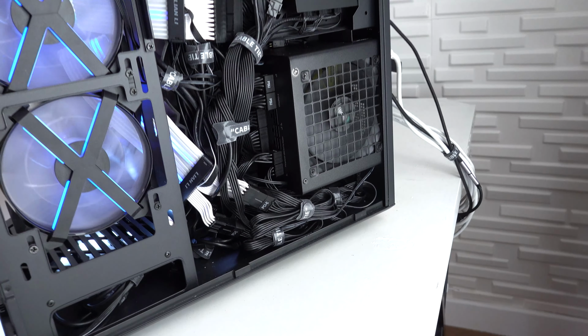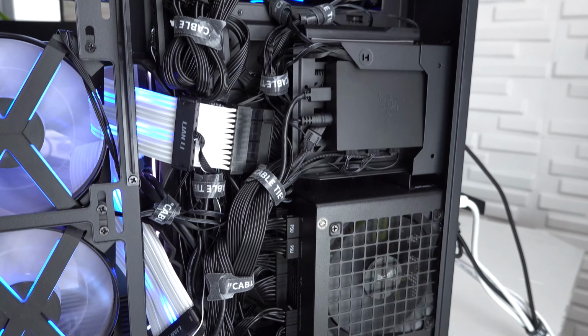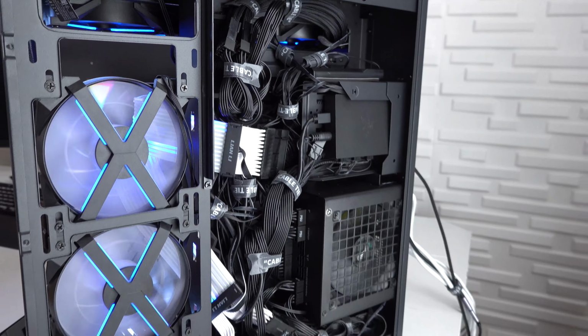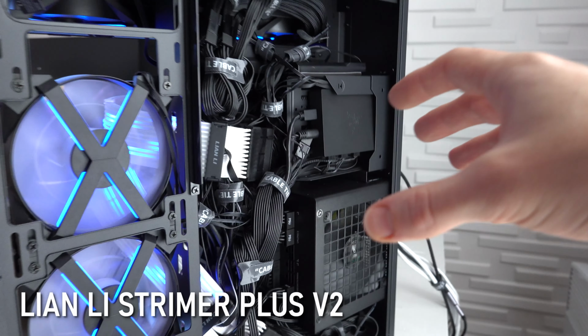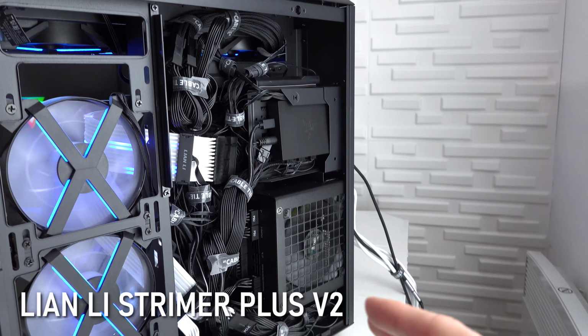So I spent longer on the cable management off camera just now and managed to get the cables to, I would say, a rather acceptable standard, given how many things are inside of here. And the extension cables really do add just a lot of extra room that's needed in the back of your case because of, in my case, these RGB cables from Lian Li. When you add them, you really do need to make a little bit more room in the back of your PC case to route the normal 24-pin cable that then plugs into the extension, of course.